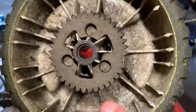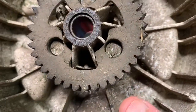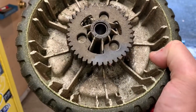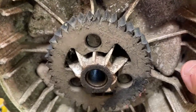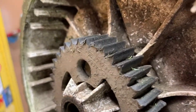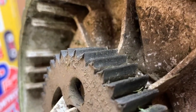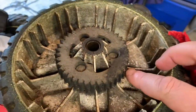You'll notice there's a little grease on there — that's okay, we need that. And there's our wheel. Let me clean this up — I'm a dummy. When I first looked at this I thought the cog was steel, it's not. It is plastic, but you can see those teeth are mashed up, the ones that are rounded off — the whole thing has had a rough 10-11 years. The teeth are all hammered down on one side — see how that one side is flatter? That's where it skips.